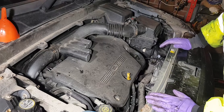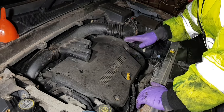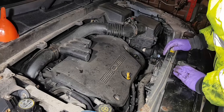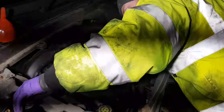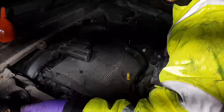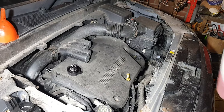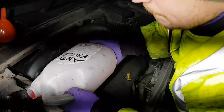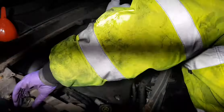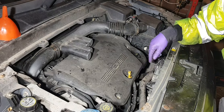There's no coolant flow in that top hose, so let's start this up and let it run. I'll just turn the engine off so you can hear me. This is the top coolant hose — what we're waiting for now is the thermostat to open. You've got your bottom hose here which is a little bit warm and then the top hose which is flat cold. Once the coolant circulates and heats itself up to about 85 degrees the thermostat opens, and it then pumps water around the radiator and back through into the engine.